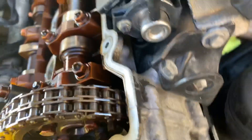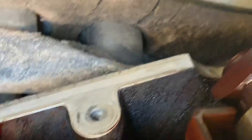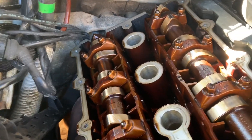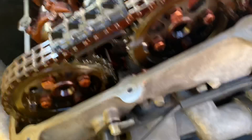Right here you can see there's a little gap — a lot of times a leak comes from there. As you can see there's no leak, it's pretty dry, just some dirt. I would also usually put some along this side as well. Depending on the gasket type, I'd put a skim coat around it, but definitely back here where the half moons are — that is definitely a spot — and right on the edge as well. If I had done that on this back one, it wouldn't be leaking and I wouldn't be doing this all over again.